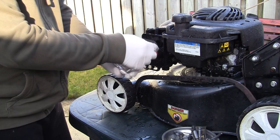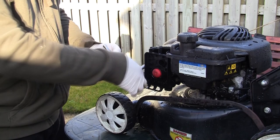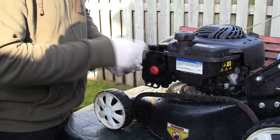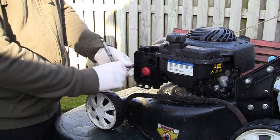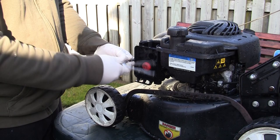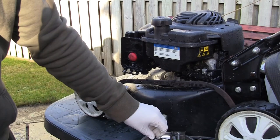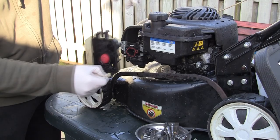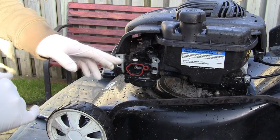The 8mm bolts go the other way in the tub so I can remember them. Once I remove this cover I can get in to the carburetor part here. There's something I don't like though - it looks like emulsification, that yellow there. That's where oil and water has probably been mixing. But I can get in now - I think the carb just pulls off this inlet here and should drop out, then we'll work out how to get the linkage off.